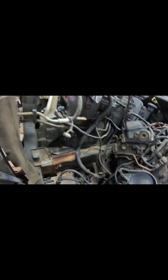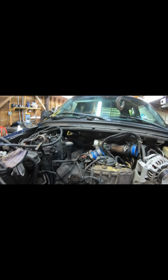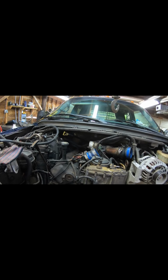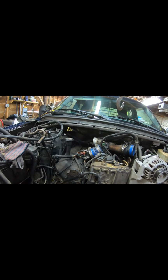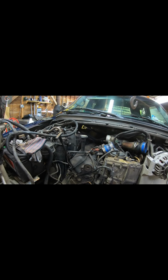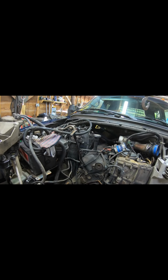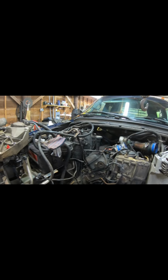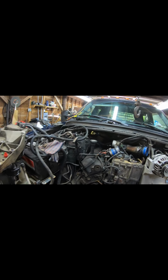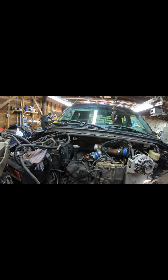And you have to jack this cab up if you don't want to pull the turbo. The turbo is way back where it's hard to get to, and they have issues with leaking back there. So I found when I pulled the other motor out, I just disconnected the first six. There's 8 bolts that hold the cab on. I totally removed the first 6, and then the last ones I left loose. That way it would kind of keep the cab aligned, so I don't have to work too hard to put it back in place.